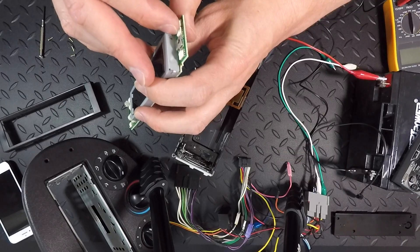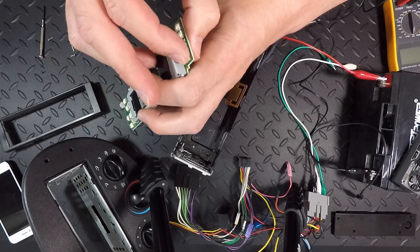The problem seems to be in my display — the volume down button does not work, it gets stuck. I confirmed that with the meter. If I hold the meter on it for continuity and press the button, it shows that the connection has been made. But when I release it, sometimes it won't release, and that's why my volume turns all the way down. I'm not sure why it also started turning all the way up, because the up volume button seems to be working fine. But when I first opened it up it felt stuck, and I think I've just jarred it loose.